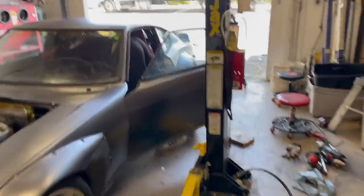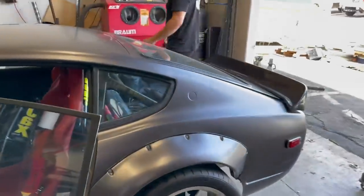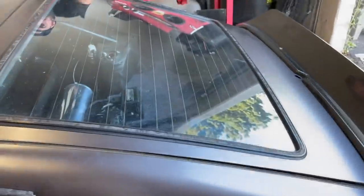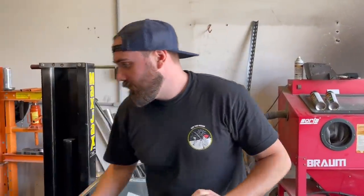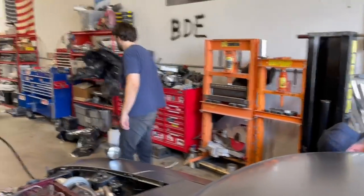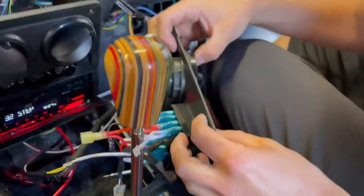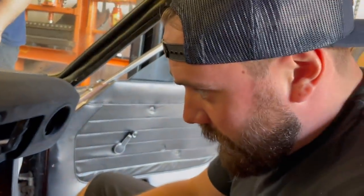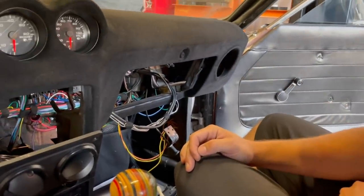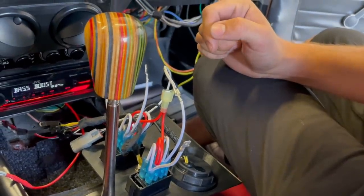Devin has arrived. We were having some trouble starting it because the glow plugs weren't behaving - everything's freshly wired on actual switches and stuff. We were thinking the battery current was too low, so we've charged it. The glow plugs pull a lot of amperage and with a bunch of other relays hooked up, we were thinking it literally wasn't enough to trip the relay. So this is our glow plug switch. We have a timer relay set for 30 to 45 seconds that will trigger the actual glow plug relay and only have them on for that long. We're just going to diagnose now and make sure they actually work and it was just a low battery issue.